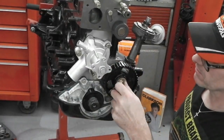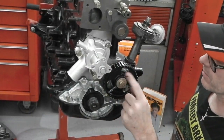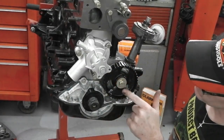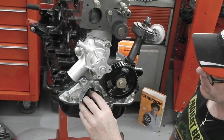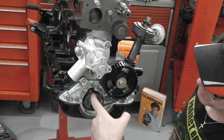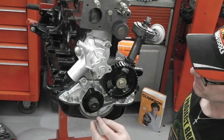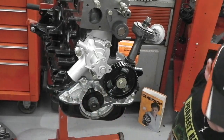So we've got that, these nipping up, we've got a bolt that goes on there, it's a fine threaded bolt, washer on, that slides on nicely. The flat face pointing out according to the book. Sprocket here, lower sprocket, the flat face points outwards, there's a standoff ridge on it. That knocks in, I've put some grease on there. That little guide washer then goes on. We don't put the pulley wheel on yet.